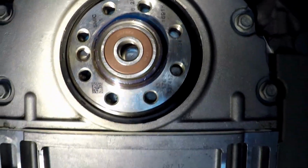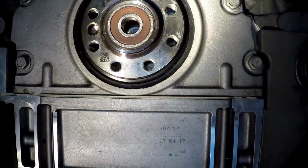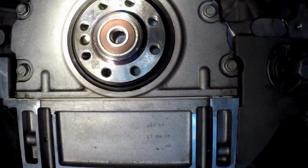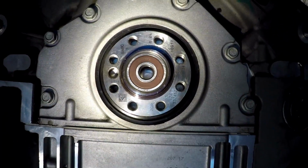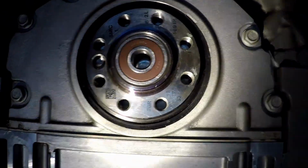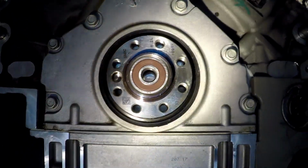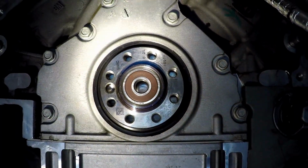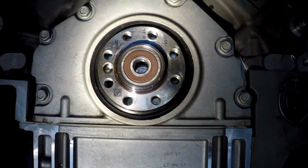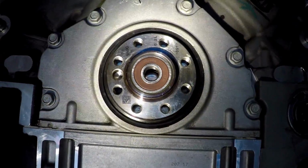But as I was blowing the holes out, I blew out a little bit of oil. So that does go through to the crankshaft on the other side of the crankshaft. Now there is a backer there, and I'm not quite sure how that's all relating. But I'm not going to spray brake cleaner down the threads to clean them, because I don't want the brake cleaner attacking the seal. I also don't want brake cleaner in my oil, but I'm more concerned about the seal there, keeping the integrity, keeping it dry, not getting anything on it at all, and of course being careful with the razor blade and wire brush. But all around that register, and then the flat surface here, double check it, make sure it's nice and flat and clean.